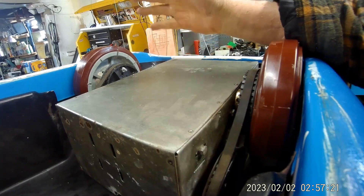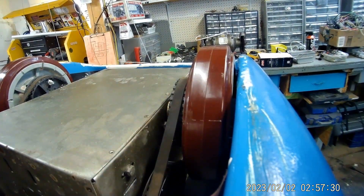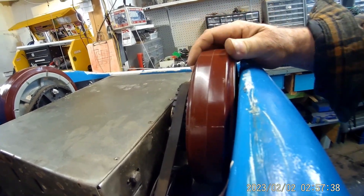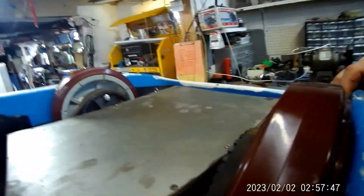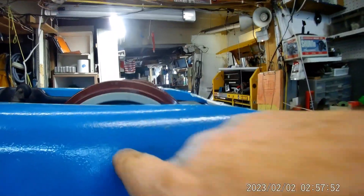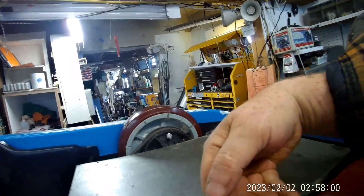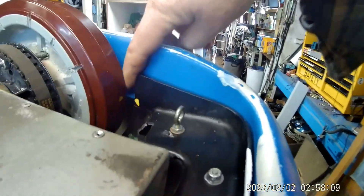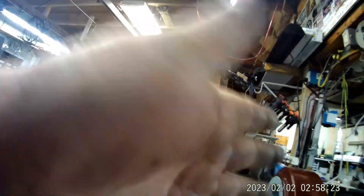There's a new axle in it because the axle that was there just wasn't working. We did have to modify this body a little bit to get it in there, because the new axle and with the wheels being a little bit wider - a quarter inch on this one and a quarter inch on that one, we're talking a half inch more. And this was that tight to where that half inch made a big difference. So what I had done, I took a two-and-a-half inch hole saw and just on the opposite side, I drilled a two-and-a-half inch hole on both sides so the axle actually had a place to fit into while we got the other side in. There was plenty of room to drill that hole, and it's fiberglass so it's nothing to worry about, and there's no weight on it.